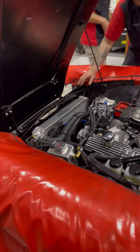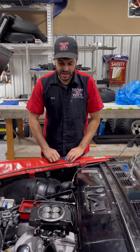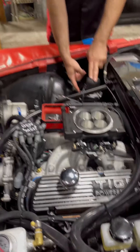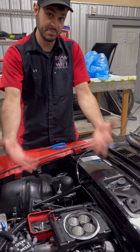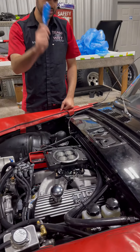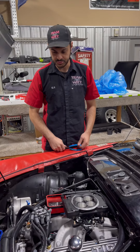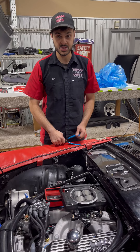And then a catch can. Fun fact about these Tiger valve covers: they're not baffled and we can't use regular baffled valve covers because they don't physically fit. So we had to use a Corvette vacuum pump — essentially there's crankcase pressure being built, and this negates that and gives us vacuum, pulling all of the crankcase pressure and oil moisture through that catch can. So that was a problem we had to solve too, but a few little hiccups and this thing is 100% track ready.